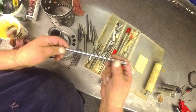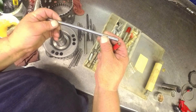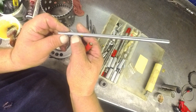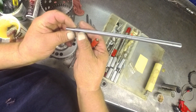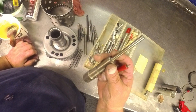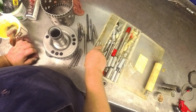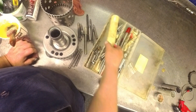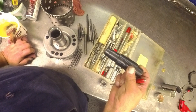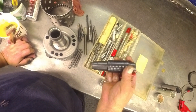I've got a couple things here set up — like for the Hondas, I've got this marked as the main shaft on the MAXA, and that's how deep it needs to be. Then the other bushing is marked up here. I made special tools for installing them — these are some tools for the Honda bushings, and it sets it at the right depth. This one here came with my bushing kit and is specifically made for the 350s, setting it at the correct depth. There are three bushings on it.